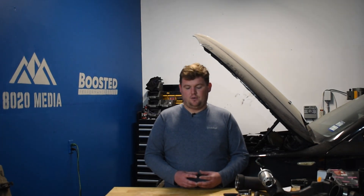Ultimately, not much else to say in this comparison. The S55 and S58 are, in my opinion, two of the best modern turbo engines, especially looking at six-cylinder or three-liter displacement engines — there really isn't much else out there that can make this kind of power so reliably. Both engines are awesome overall. They're both showing to be very reliable, and apart from those crank hub issues on the S55, that's really the only major flaw either engine has. Normally, if we compared the S55 to almost any other engine, we'd be giving it such high praise — but unfortunately for the S55, when you compare it to BMW's newest S58, it just pales in comparison. The S58 really is a perfectly designed engine from top to bottom.